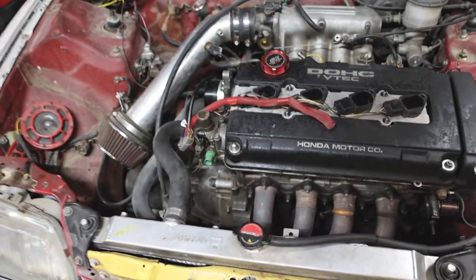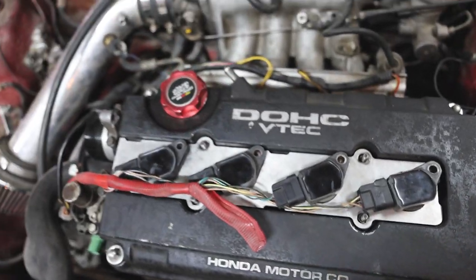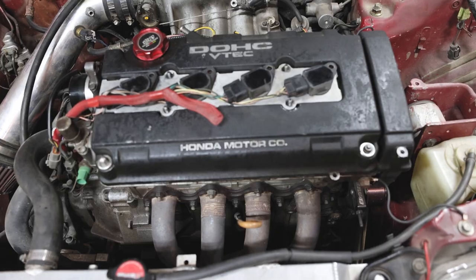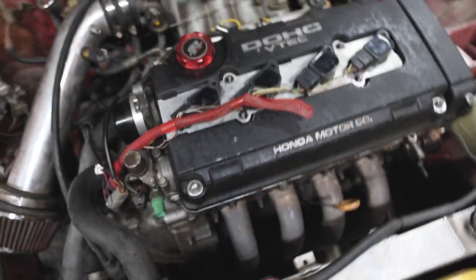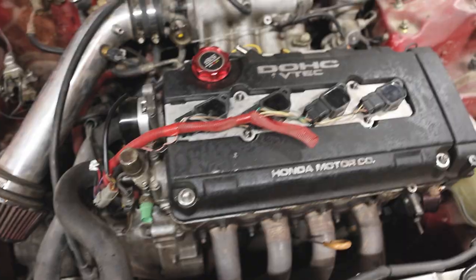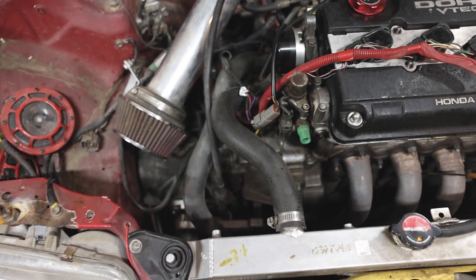Here is the heart of the beast. It is a B18 B1 block with a built GSR head — coil on plug. It's a really nice built head. The spring retainers and all that stuff is aftermarket. It pulled hard and cracked really loud VTEC, so I'm pretty excited about that. It's got the AEM coil-on-plug kit. It's also got the bigger Skunk2 radiator. You can see where the tree actually hit — it whacked the tree pretty good there, which was the reason it retired from the last rally. The transmission has been rebuilt with new synchros and everything else, and it shifts like butter.